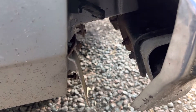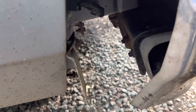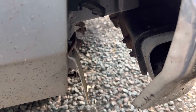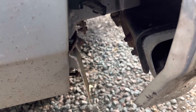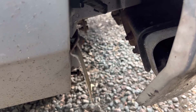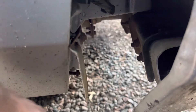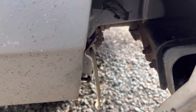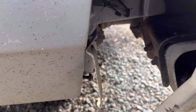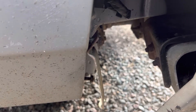The bumpers will have to come off. Good news — there are only four bolts on each side, and then the bumper comes off. If you crawl up under there, you'll see the four bolts, like you can see right there. It's four bolts on each side, so a total of eight. Once you bust those eight off, the bumper's coming off.